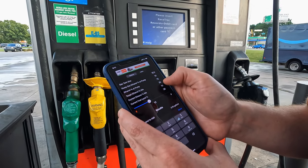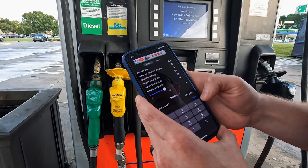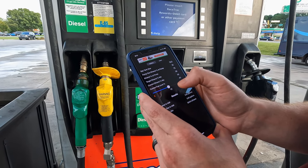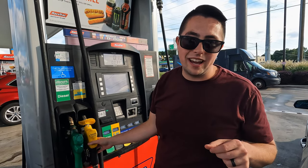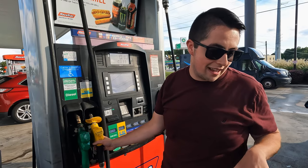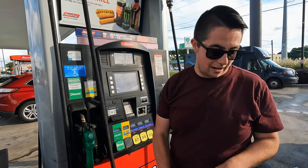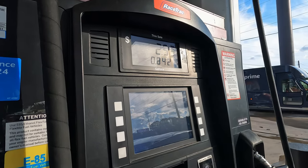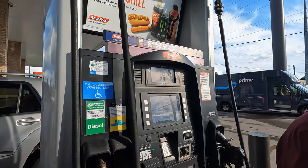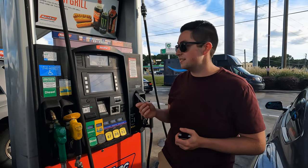Target ethanol mixture is 30%. Current ethanol mixture — since this is my second time doing this and I already have E30 in the tank — I'm putting 30 in there. I checked the gauge on the Cobb access port and I have 41% fuel in the tank right now. With that plugged in, we're gonna be pumping 2.81 gallons of the E today. Then we do it one more time and add 6.33 gallons of 93 octane. Close enough — good enough for me.